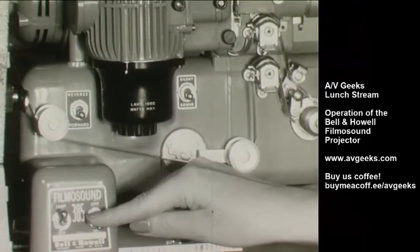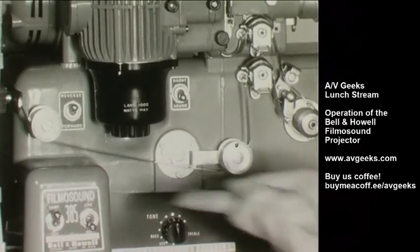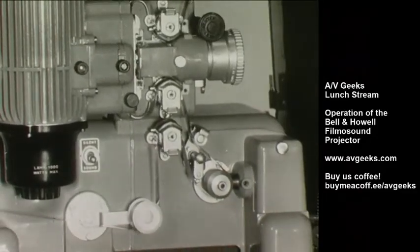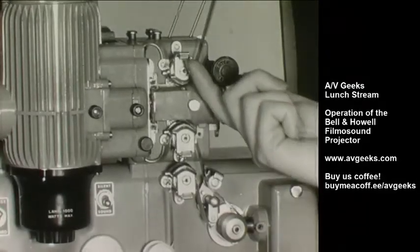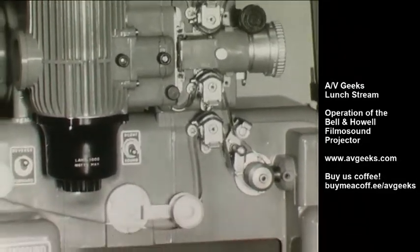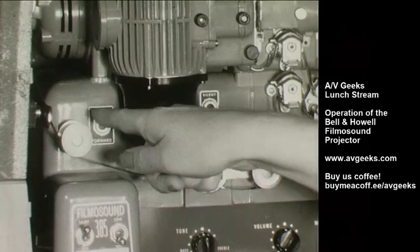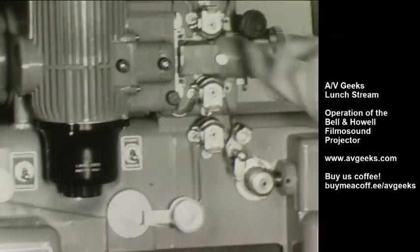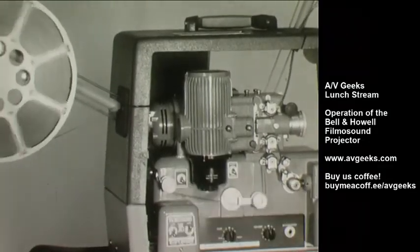Turn the power line switch off. Set the forward reverse switch to the reverse position. Turn the power line switch on. Turn the clutch control clockwise, and now the projector is operating in reverse. For forward movement, turn the clutch control counterclockwise, turn the power line switch off, set the forward reverse switch to the forward position, turn the power line switch on, the clutch control clockwise, then the volume control up. When the picture has ended, turn the lamp switch off and the sound volume down.